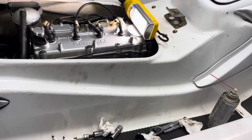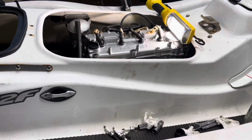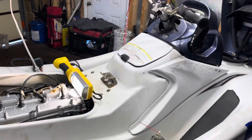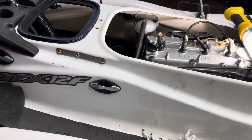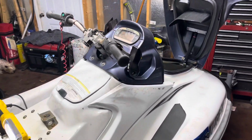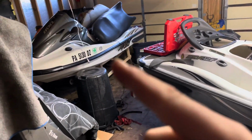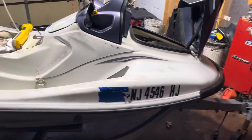This is literally straightforward. So I hope I was able to inform you guys how to do it. This could save your block from freezing and cracking. So once spring comes around, just press that start button and she'll start right up. With that being said, guys, thank you for watching. This is the STX12F, and we just winterized it for the season. So I'm gonna throw her right next to the other one. That one's gonna get a motor rebuild, and that's where she'll stay for the winter, inside, away from the elements.